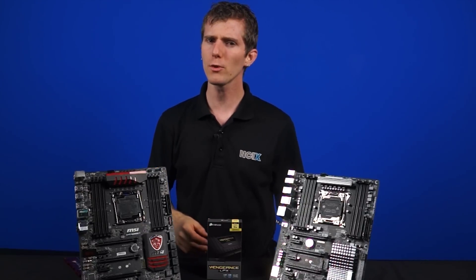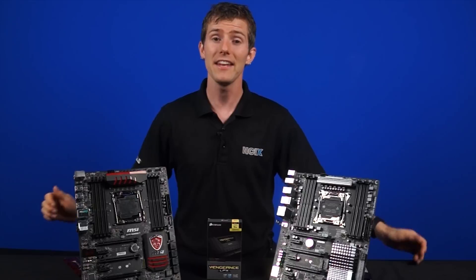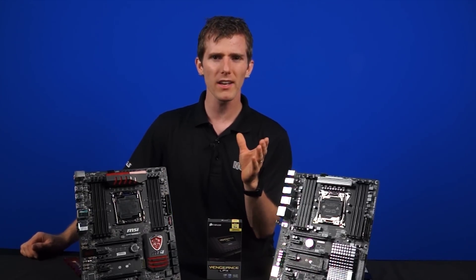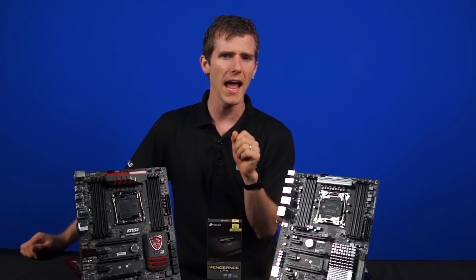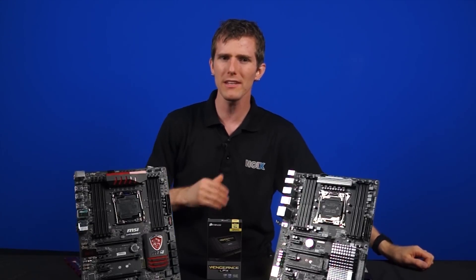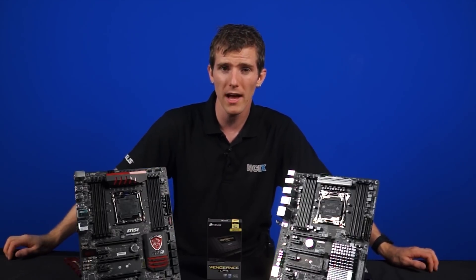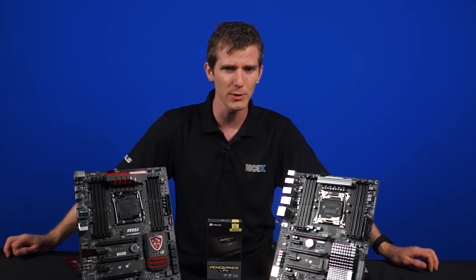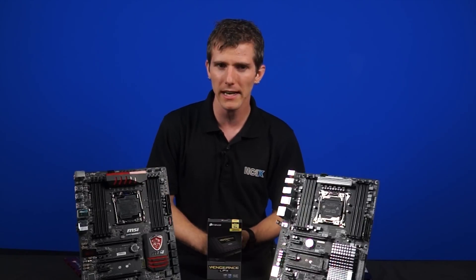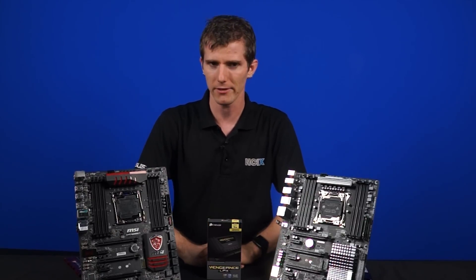The last notable change is an update to Intel's Extreme Memory Profile system, XMP, called Intel Extreme Memory Profile 2.0. It actually affects your CPU's base clock and multiplier now as well on some motherboards. We noticed that using XMP profiles actually increased the base clock to a 125 strap on the Xtreme Edition CPU, while lowering the multiplier and locking in at a higher CPU frequency. Whether this is motherboard manufacturers taking some liberties with the XMP spec, or whether it's something we're going to see more of on an ongoing basis, remains to be seen.